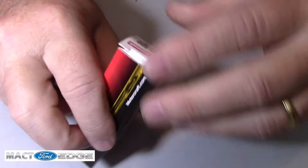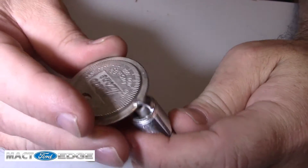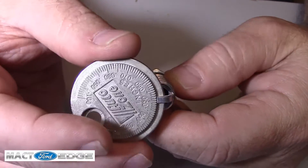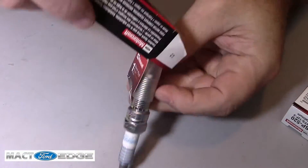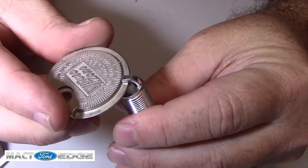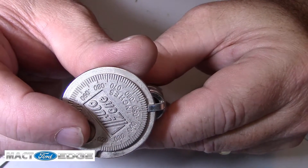Let's go ahead and check the next one — get it out of the box and check this one here to see where it is at. That one is .051 as well. So two of them at .051. Let's see what these other four do. Spark plug number three — let's get this one checked. Looks like we got a .052 for this one.